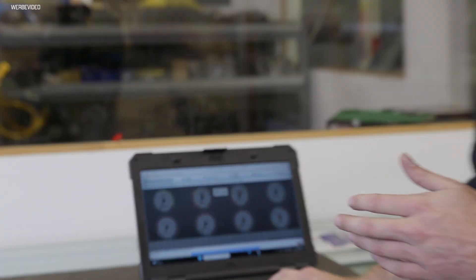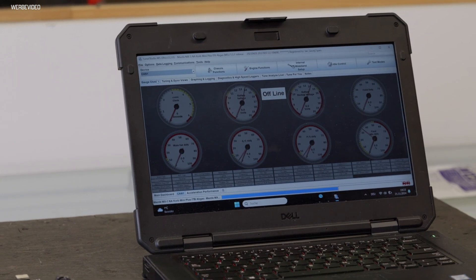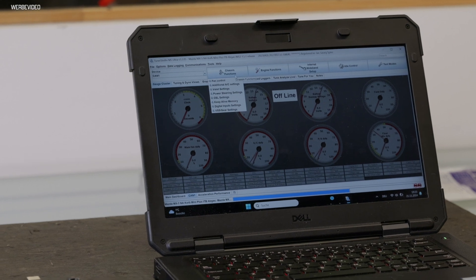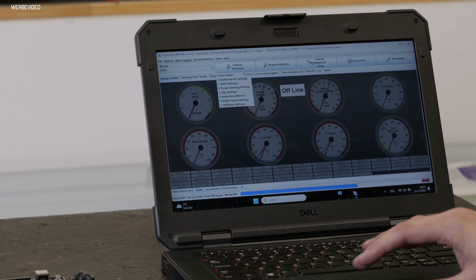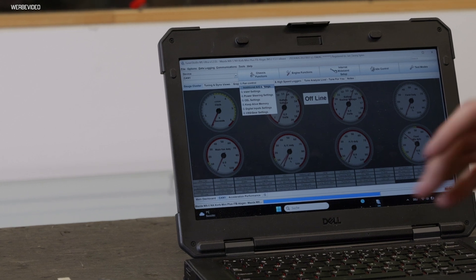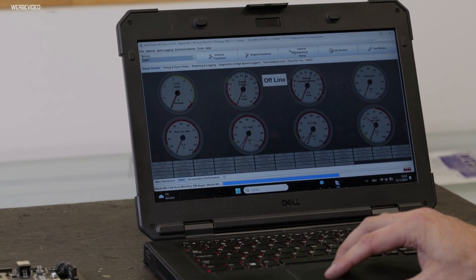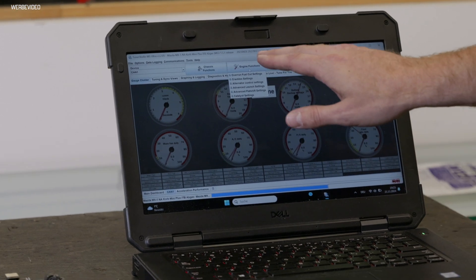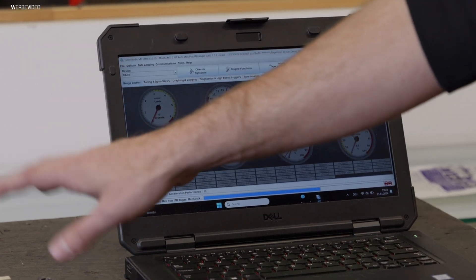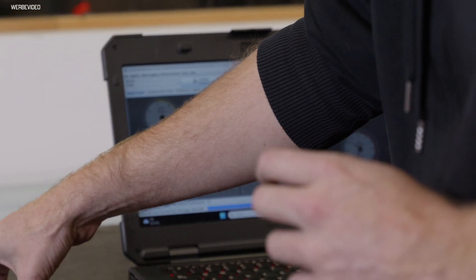You know that screen — this is the normal TunerStudio screen. We have the CAN1 board, which is the add-on that DMI made for us. In addition to the internal wideband, we have chassis functions: we can turn on your OBD light if you want, we can differently control the AC, we can differently control the fans, we have a power steering setting, different overrun settings that are more accurate to a standard OEM car, and a really comprehensive way of controlling the idle.